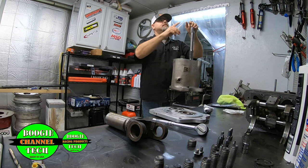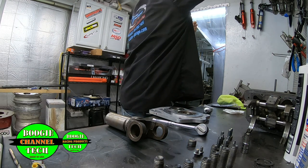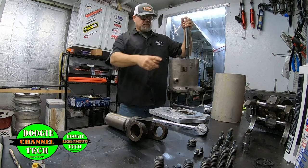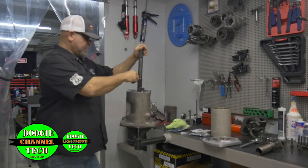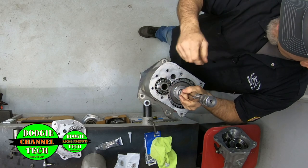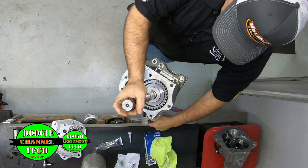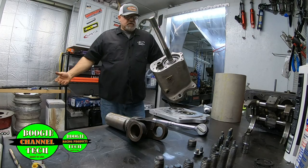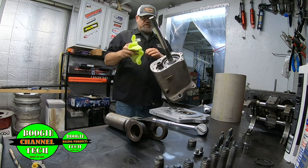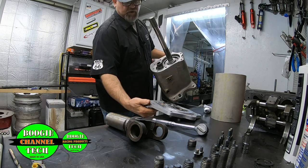I've got a piece of pipe right up here, a piece of aluminum that I have made that I take with me to the track. I set it on a table, I set it right there on that. I can literally pull first gear off the main shaft nut, and I'll pull the cluster out because my first gears are made to the cluster shaft. Nothing. I can change first gear in no time. And everybody says, well, what does it matter about changing first gear? Well, I may want my 60 foot a little better, or I may want to do something a little different. You don't never know. It's always worth trying.